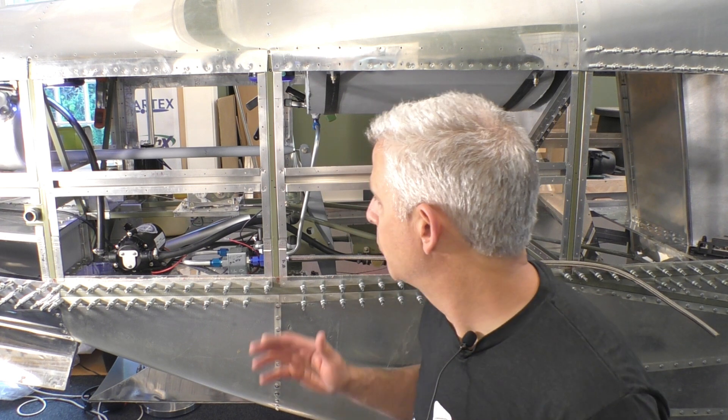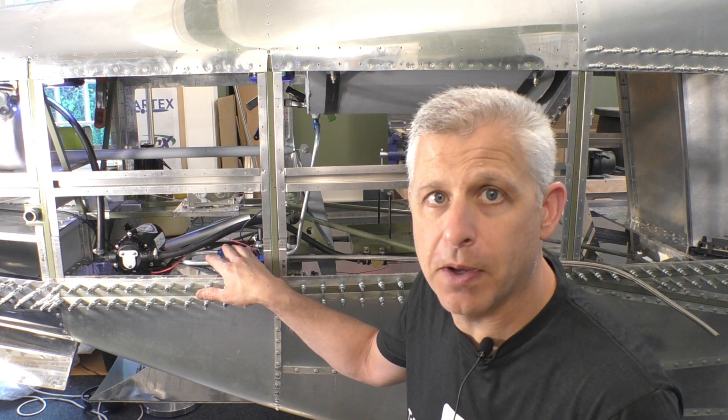We've decided that we want to use it in a way that we burn fuel down on the mains until we're at least 13 gallons down, then turn on the tank and transfer the fuel from here to refill the tank, switch it back off from the cockpit, and we're done. No more fuel management. In order to make that happen we're trying to decide whether gravity feed will solve it or if we have to have a pump, so we're going to run some tests. I've put a Facet fuel pump in here.